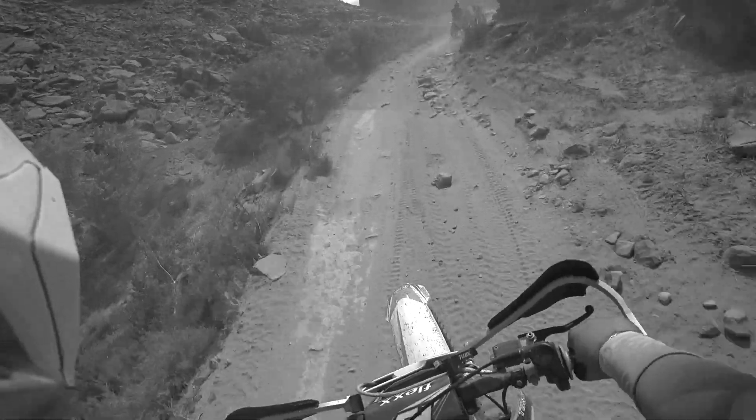We've run this bike through a few heat cycles, and now we're ready to follow KTM's break-in procedure. For the first three hours, do no more than 70% throttle, and for the two hours after that, stay away from full throttle. If you have any comments or questions, comment below, and subscribe if you want to see more videos on how to keep your two-stroke awesome. I'm Chance with Rocky Mountain — thanks for watching, see you next time.